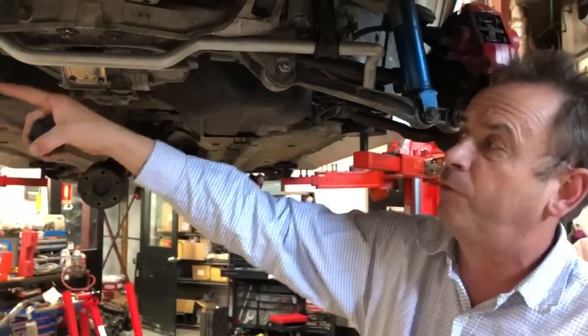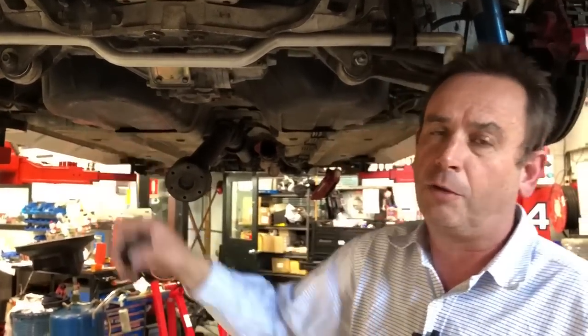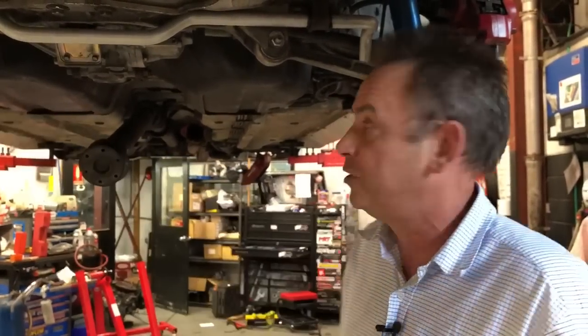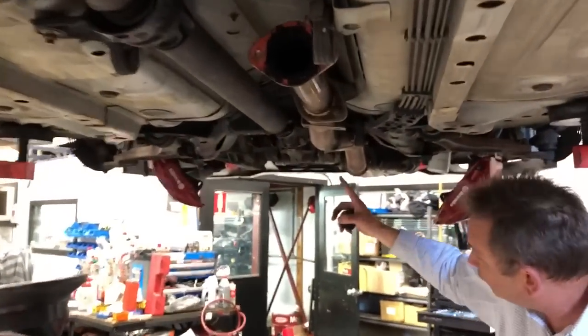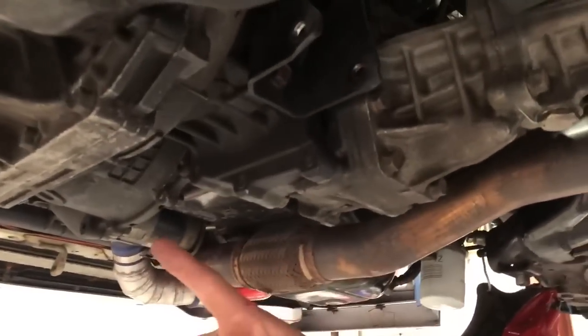And this particular bar from White Line comes with that lateral lock, which is effectively a stopper to stop the sway bar moving sideways when it's pivoting in the poly bush, which is a grease bush. You can see the tail shaft is disconnected from the rear diff, and up the front here you'll see the transfer case on this particular model car is where it comes out of the right angle drive from the front